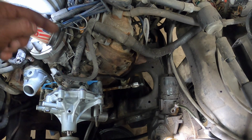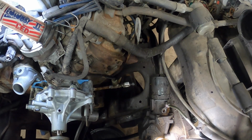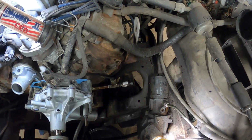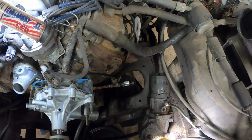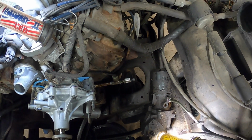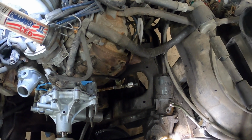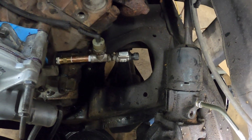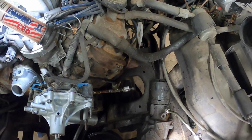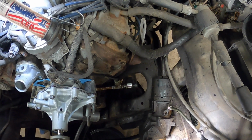I'm keeping it though, because I like the idea that if you do have an actual oil pressure problem, not only will your new gauge show it, not only will your dash gauge show it, but your red engine light will come on as well. And since I am building this thing for my wife and not myself, I would prefer that every idiot light in the dash function as Ford intended. So that's what we're doing. We got both sensors installed, just with a T on a pipe. Same way I did my green one, works fine. So next step will simply be to start wiring up the gauge.